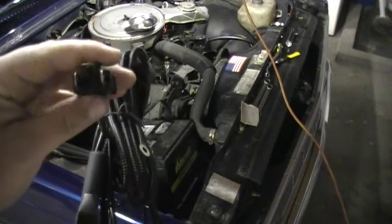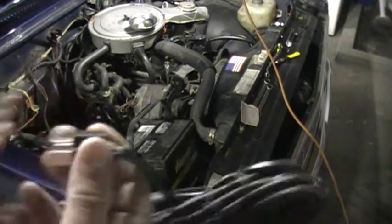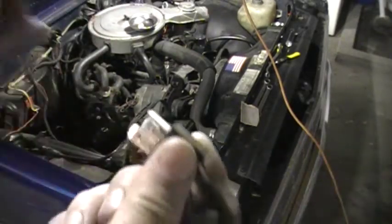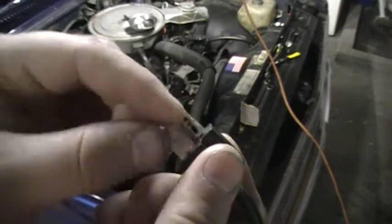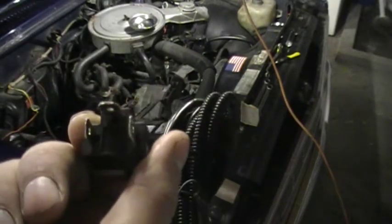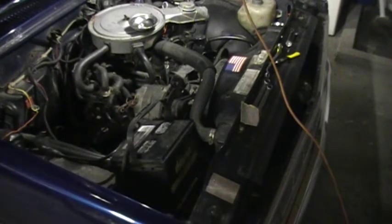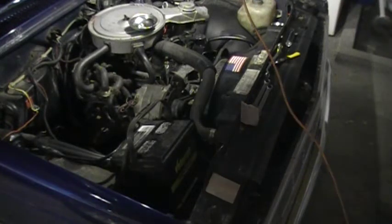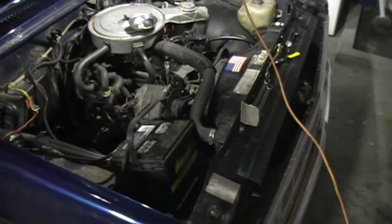But I have 9003s in my truck right now. This is what the back of the 9003 bulb looks like. The bulb would be out here, and then you have these three prongs sticking out the back. The factory harness has a female end that has connectors that fit on here, and it just plugs right in. So basically you just unplug your bulb, and this plugs into only one of your harnesses. It doesn't come with one for the other side. It basically just sends a signal to turn your HIDs on. So let me get some gloves. Let's start.